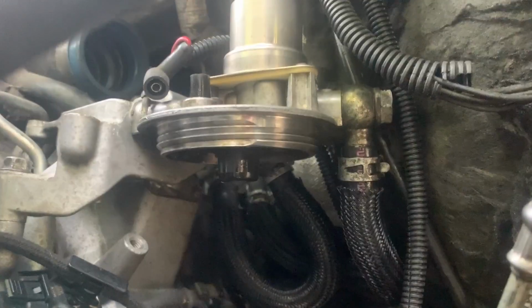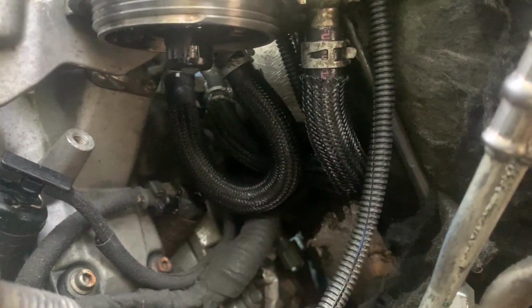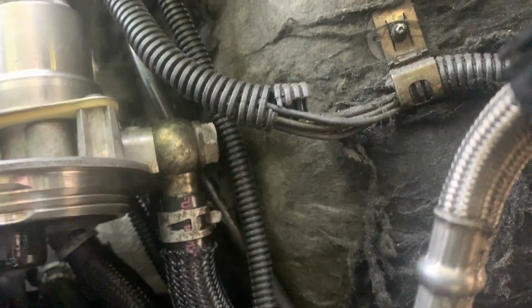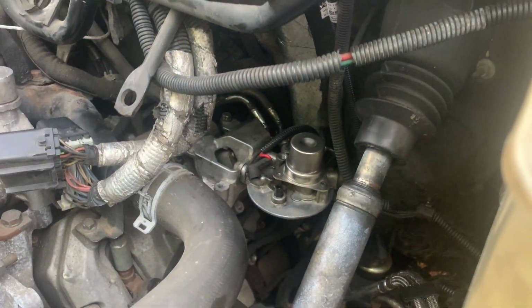Got it back in the truck. All right. So there's the 2. Definitely recommend purchasing these hoses. It's just very tight. This bolt is nearly touching the firewall, and that's the factory position. So it's just tied up in there. I'm gonna put the fuel filter housing in while it's still kind of open. A little bit easier to get a wrench in there at the moment. But it's only 2 actual bolts that hold that on.